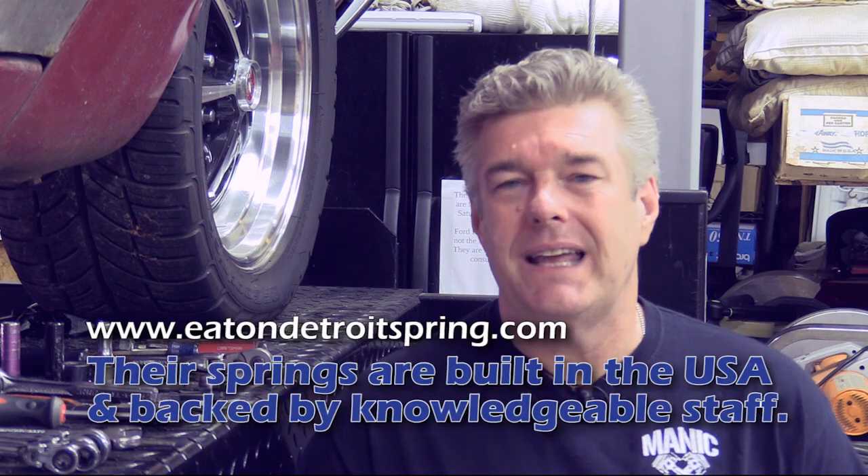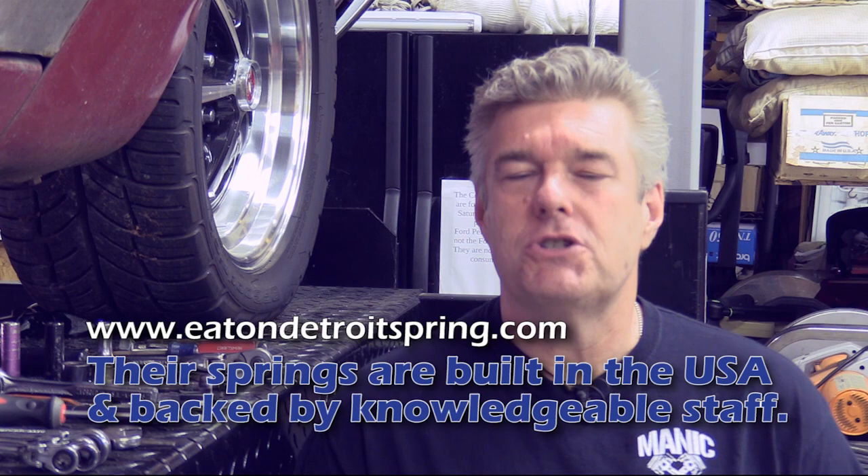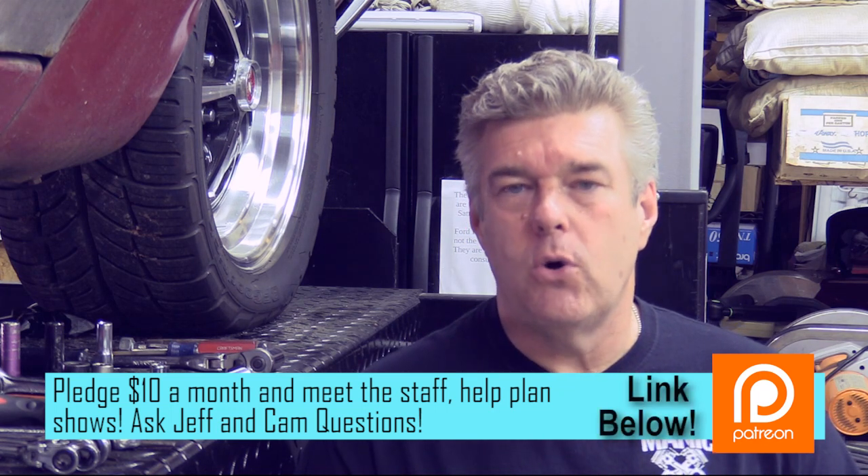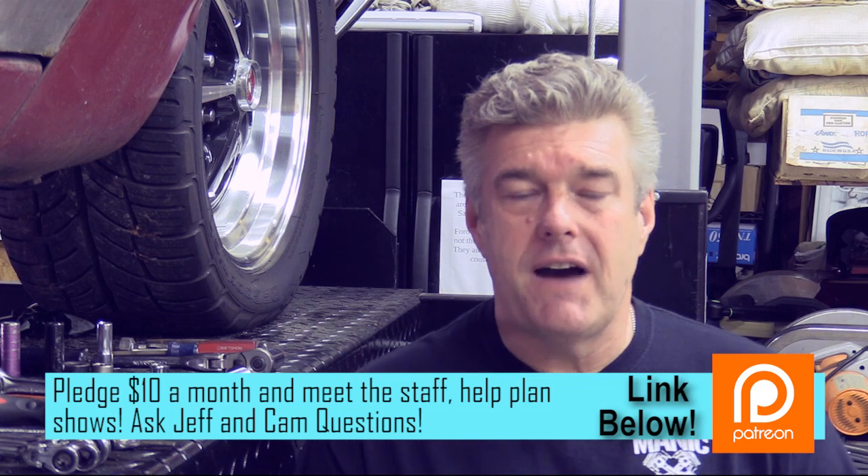You'd do better to call somebody like Eaton Detroit Spring and say you want a performance spring for your car. They're going to upgrade you to the GT springs, and you'll want to go ahead and get hydraulic shocks rather than gas. You will have a nice handling and riding car that you can adjust the shocks to beef up if you want to push the car around corners hard. I set mine at about a five on the Fairlane with stock springs, though unfortunately Steve's brother cut a coil off them — I don't much care for cutting coils — and now my front end is so low I can't even get a jack underneath the front of the wagon.